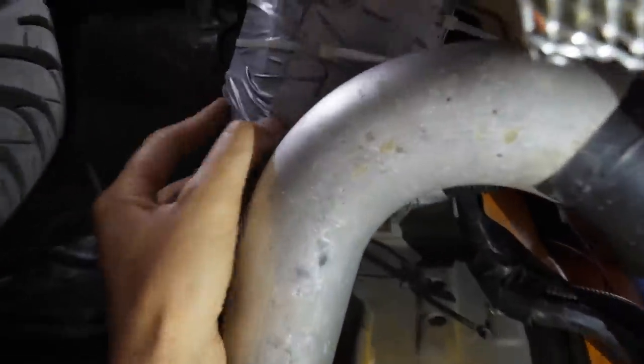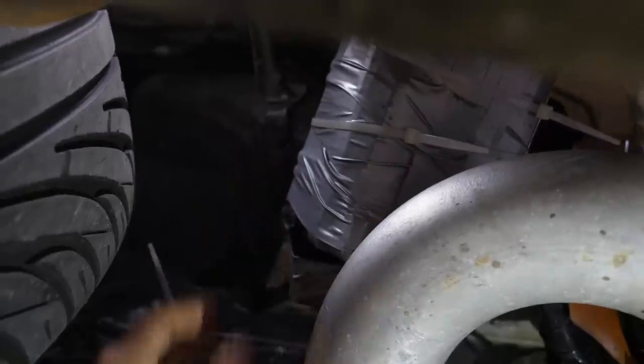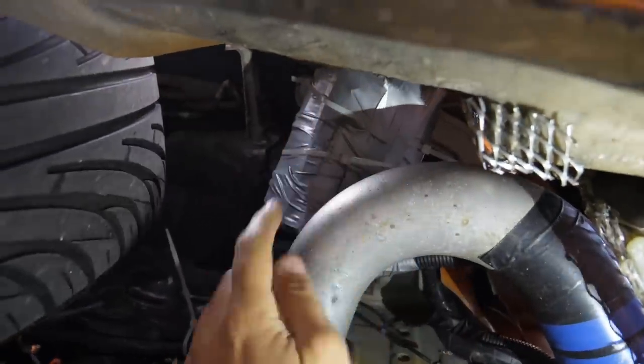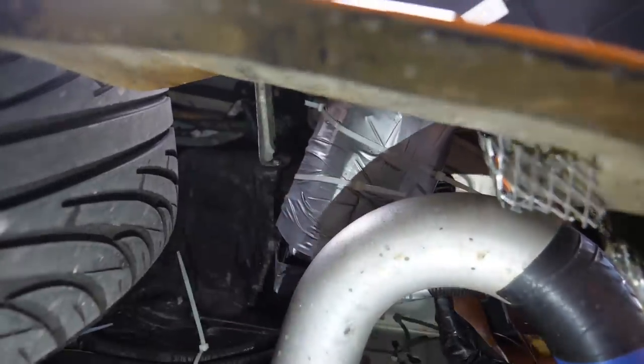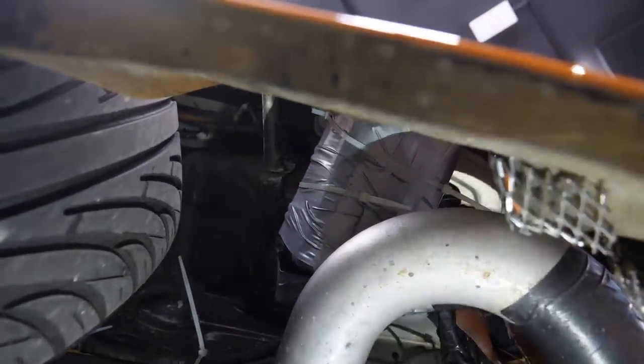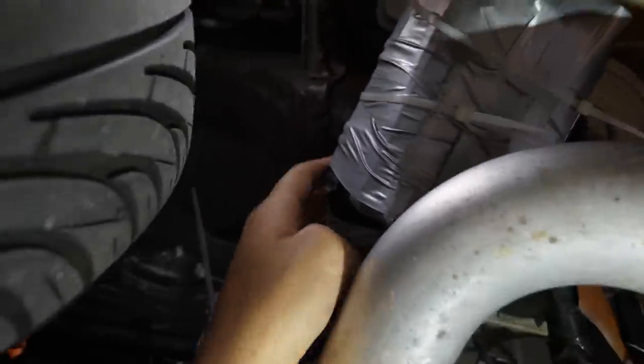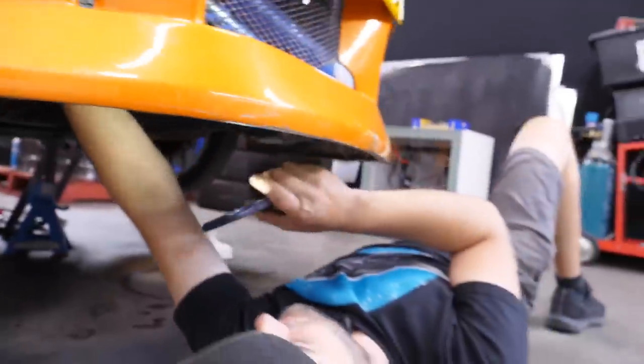That's the fuse box, dude. Yeah. That's the main distribution block for the whole car. Just sort of jammed up there and gaffer taped and then cable tied and chopped off. It actually looks like a pack of illegally imported goods, doesn't it? What is that? Has someone put fuel hose over the wiring? Is that what we're looking at there? It looks like there's wiring through there, but it's going through fuel hose to insulate it. Because I can't figure any other reason why that would be like that.